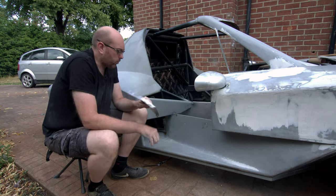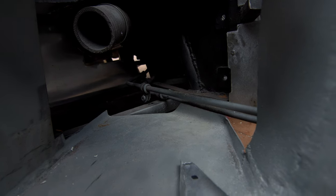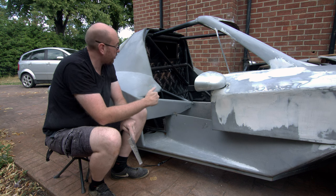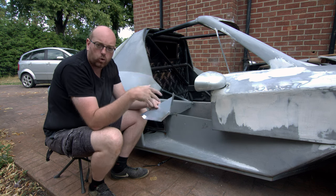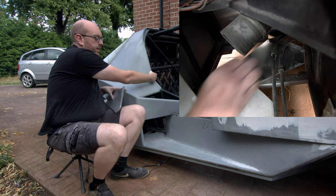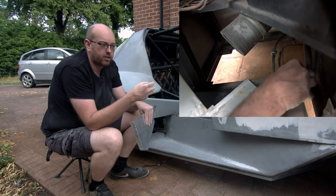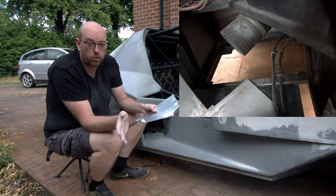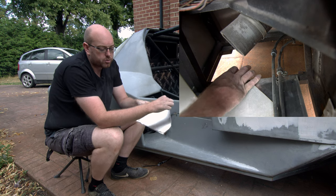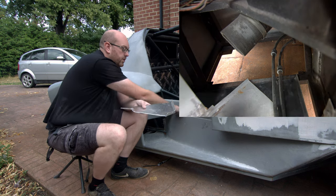The job of these trays is to direct water from the intercooler flow underneath it and dump it down into the very back section of the floor, rather than the forward section. I don't want water sloshing around up front, particularly not on a very big panel that goes edge to edge — if that rots, swells, or warps it'll be really difficult to replace. The panel at the back is only about 10 to 12 inches by 15 inches, so we drill a couple of holes through it and when we accelerate the water runs back and dumps out. The chances of nothing getting through are slim to none, so hopefully this small return stops whatever water does get past the intercooler from reaching the forward floor section.